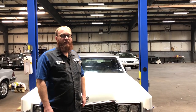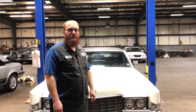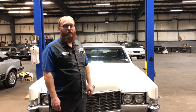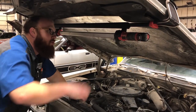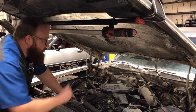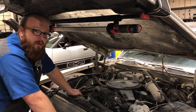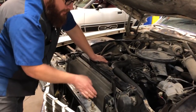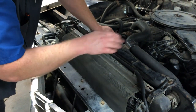Next, we'll take a look under the hood. On this car, there's no hood latch to pull under the dash — you just reach under the grill and open it, just like a 1995 Dodge Viper. I'm using my Milwaukee light stretched to its limits on this big hood. Working from the front: you're not going to be able to check every bolt with the seller standing there, but take a quick glance. This one has screen over the condenser — many old cars have that to keep bugs and birds out. I'll probably just leave it.